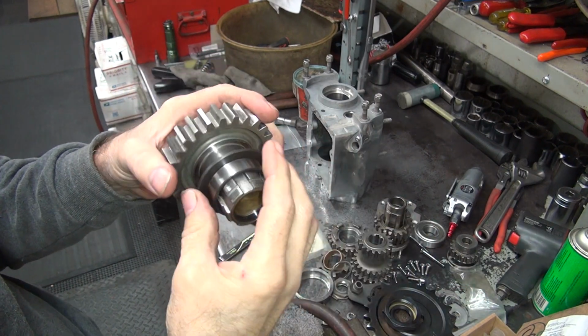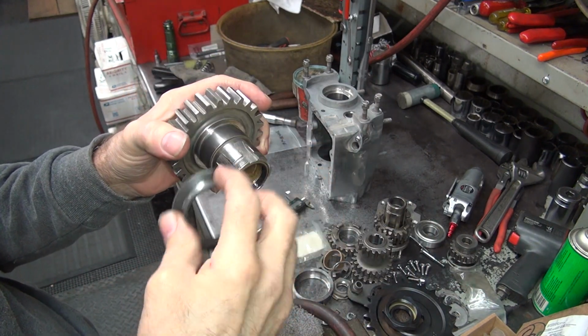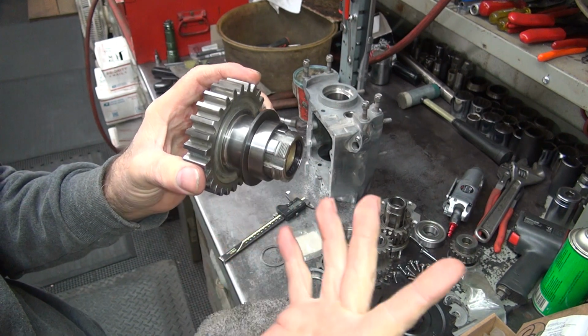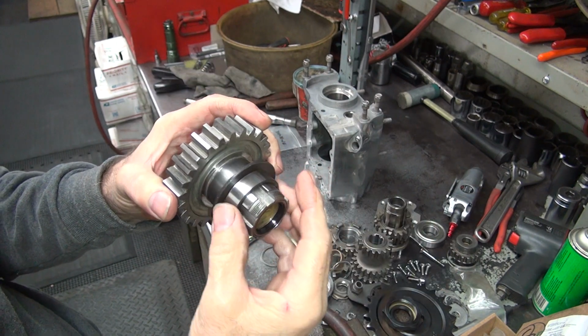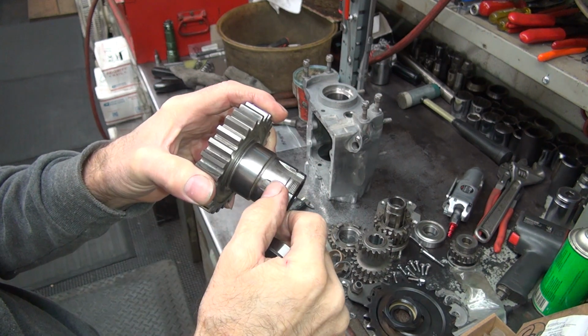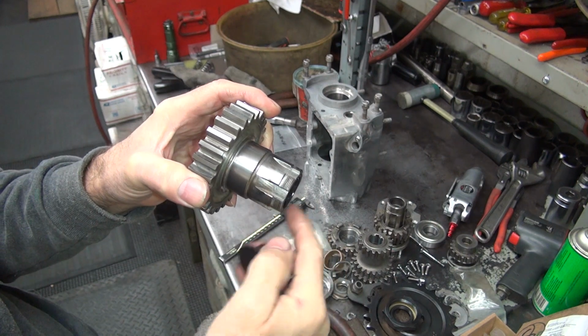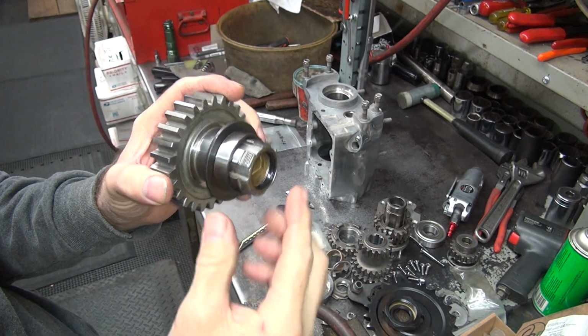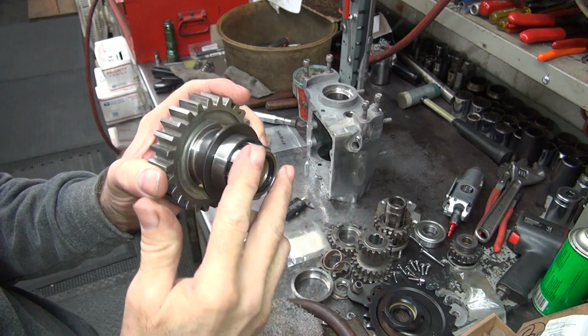It's a bad design. So all those guys selling these modified spacers, it's a bunch of crap. They weaken them up. Basically it's loose, it's going to leak. I don't care who makes it. Now what Andrews does is they take the gear and move this out further, and they actually put a groove right there and put an O-ring in there, like a new bike, like a 5-speed. So Andrews does that on their tranny. So that's the only good one you've got.